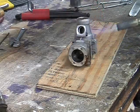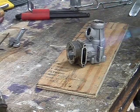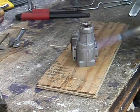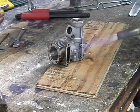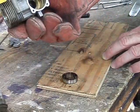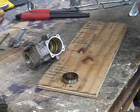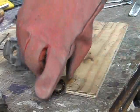You can also simply pop it back in the oven at up to 350 degrees Fahrenheit — it may take 10 to 15 minutes. By heating, we're expanding the crankcase away from the bearing. Once hot enough, lift the engine up and slam it back down on the plywood flat on the backplate — inertia of the bearing will cause it to drop straight out of the motor. There's the hardest bearing to remove. You can see it's worn, not rusty, just worn.